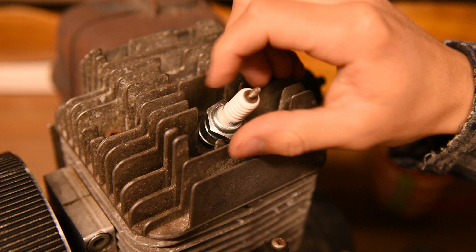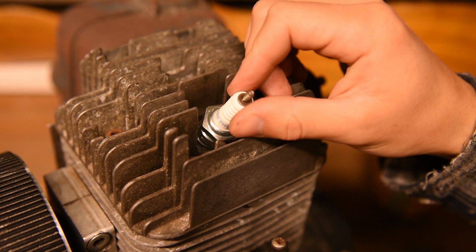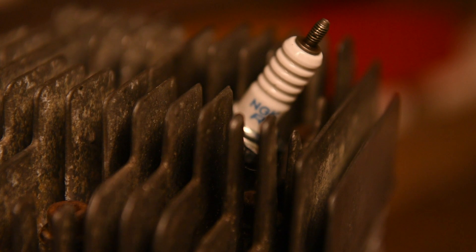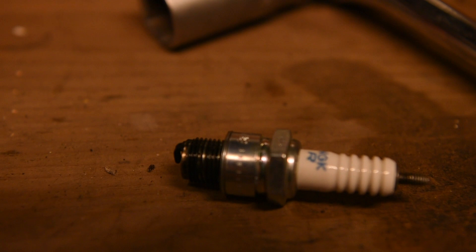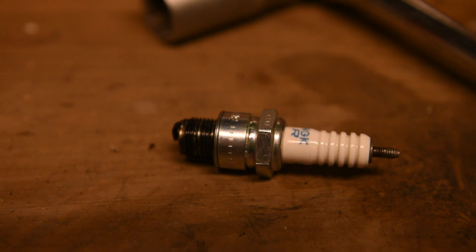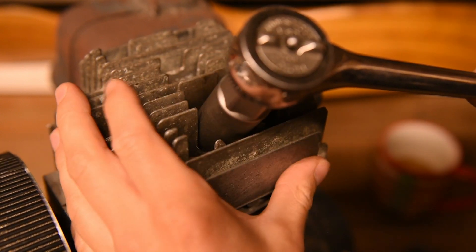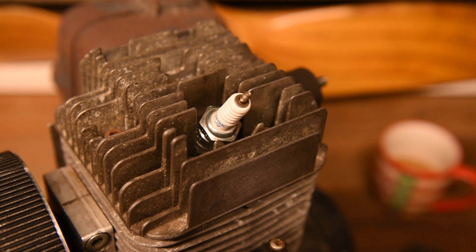When it comes to refitting your spark plug, always check your owner's manual to make sure you set your torque wrench to the correct torque setting. If you haven't got your manual or torque wrench to hand, a rule of thumb is to just nip the spark plug and don't over-tighten it because you will damage the threads. They have a little crush washer on them so they should hold themselves in place. Just nip that — do not over-tighten.